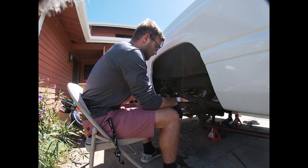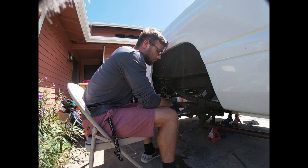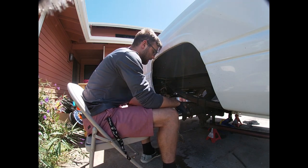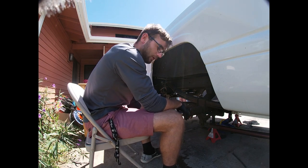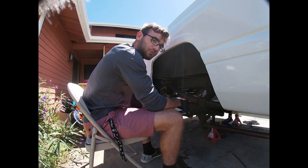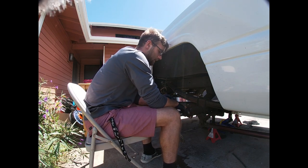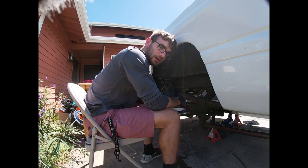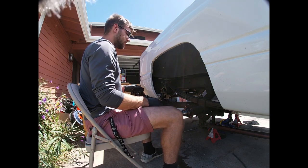And then I'm going to actually kind of try to angle it without putting the front bearing in, squirt a little bit of gear oil in it, and then I'm gonna put the front bearing in, which I actually already did on the other side. And then I'm gonna put the front bearing in and the nut on, and then not so much that it's gonna leak out, but enough that when I start to spin it, it'll get some gear oil in there, because there is gonna be constant gear oil flow in this hub. Anyways, it's a continuous flow, so you don't need to actually grease them. If you wanna go buy the OEM book, you can. You're not gonna hurt anything. I just don't want to do that. That's a personal preference kind of idea. So first things first, actually here, we're going to take our hub.